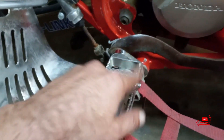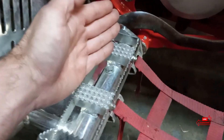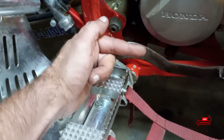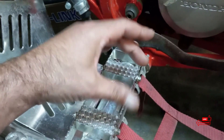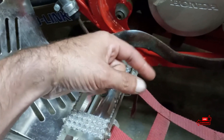The foot peg should actually be about in this location. I keep my foot like, I got to move my foot to get to the brake, which is not good. You want to be able to hit the brakes without having to think about that. So we are doing something about this. I have AC Racing full Nerf bars for this, but the ones they sent me were for 88-89. So I gave the original foot pegs off my other 86 TRX 250R and the brackets to a buddy of mine who does fabrication for a living. I will insert some pictures of how he customized those so I could use the ones I have on the 86, even though they're for an 88-89.